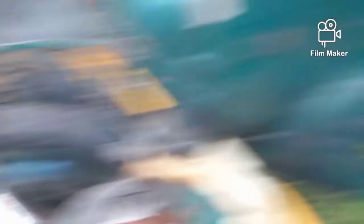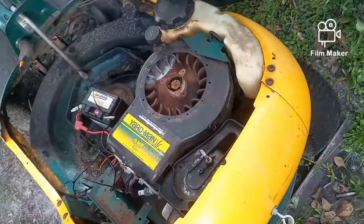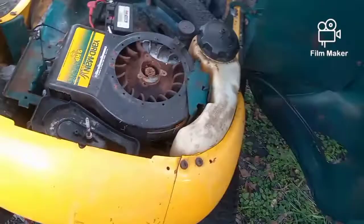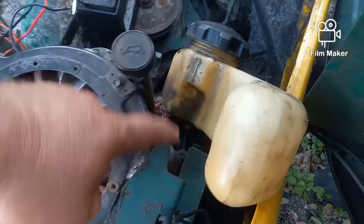If your safety switches are all messed up — some disconnected, some not — you need to take this top cover off. There are two screws right here, one and two, that I've already loosened. You have to take out the fuel tank, which I've already undone, and there are two more bolts — one here and one right here. Take all four of those out, and also take the screw out of your dipstick because you're going to need to move that out of the way.